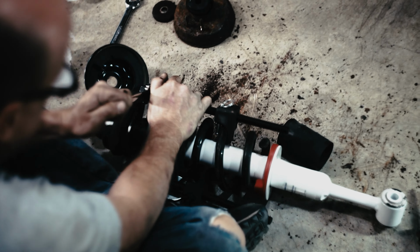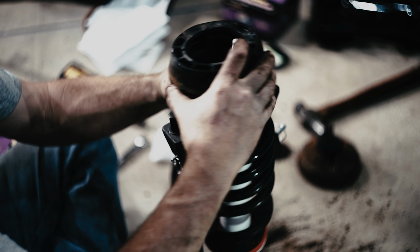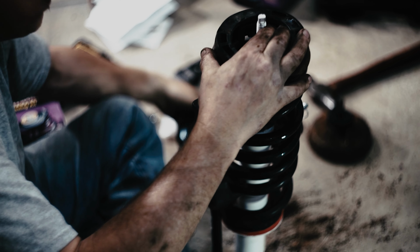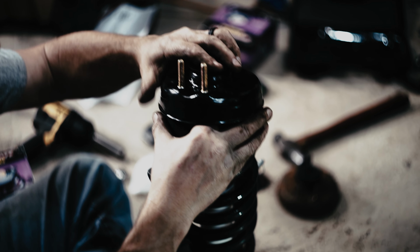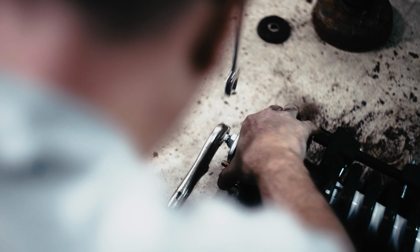With the spring compression taken off of the old strut, you want to keep that compressed until you get it safely put onto the new strut. In our case, we also use new hats, which is the portion with the bushings and sometimes the bearings at the top of the strut. Now that I have the hat, which is also known as a strut mount, secured to the new strut, I can let the tension out of the spring, making sure that the spring is seated into the rubber bushings. It's time to get the new ones in.